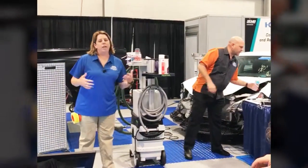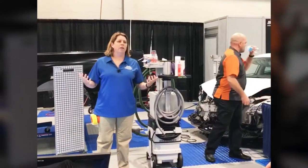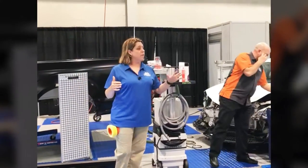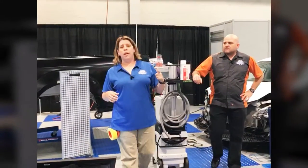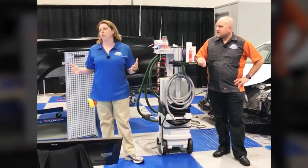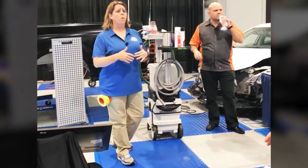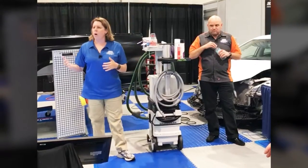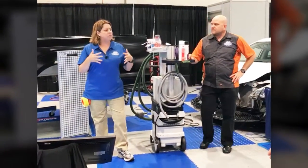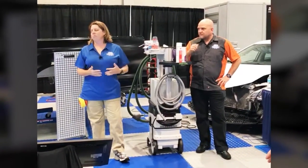If we can drive home a point to you today, I always tell people that about 20 years ago when I started in the business as a technician, I could have five skills, and those five skills could fix pretty much any car that came in the shop. I could fix a dent, pull a frame, replace a panel, weld, paint, I could do everything. Those skills just aren't enough these days. We're really working on rolling computers. Even if I remove the sensor, or I have frame damage and I'm having to realign the car, there are so many things that have to be replaced. When an OEM issues a statement on scanning and recalibration prior to delivering the car to the customer, folks, there's a reason they're doing that.